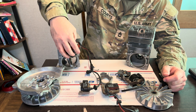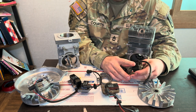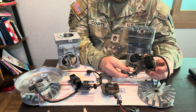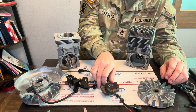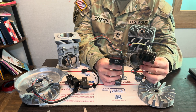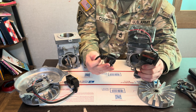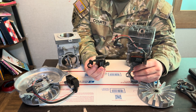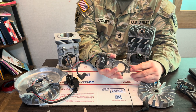It'll float up above your flywheel. So let's say you want to upgrade your vintage point system — the points, the condenser, it's all gone. We don't want to use that anymore; there's better technology like the PVL coil. Here's an example where somebody has retrofitted the vintage stator plate with a modern PVL coil. I have a YouTube video linked in the description that shows how you swap this coil onto your vintage stator plate.